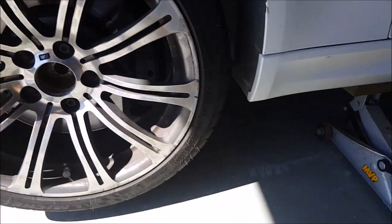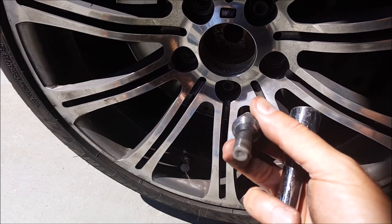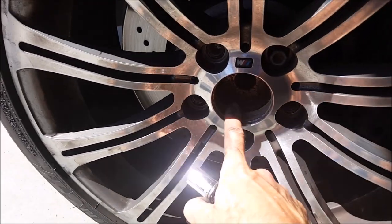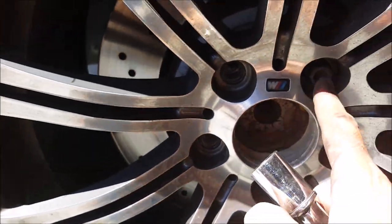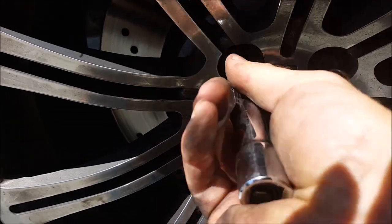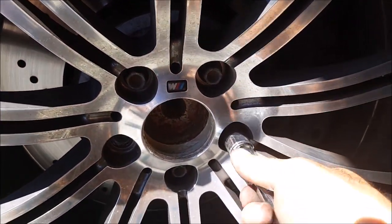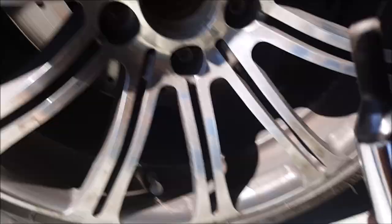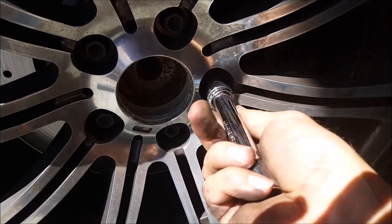I've got the front summer tire on, just putting the last three lug nuts in. With BMWs, you don't hang the wheel off the lug nuts like on most conventional cars. Japanese cars have the lug nuts on the rotor and you just pop it on. Here, there's a hub-centric ring that the rim sits on, and you just have to line up the holes for the lug nuts, then put them in a star pattern. Hand-snug each one in sequence. You'll notice the wheel spins freely, which is why you want to loosen the lug nuts before jacking — otherwise you'll never get them loose and the wheel will just spin in the air.